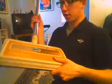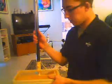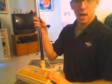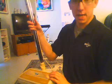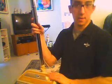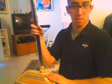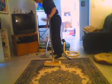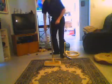So with a new motor, because the old one quit, what happened is there was a lot of rust on the bearing plate of the motor. So the armature was constantly rubbing against it, and eventually the motor quit and overheated. So I had to replace the motor in the power head. But now she runs fine. Other than having to replace the motor in the power head, the Compact has been working flawlessly.